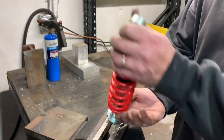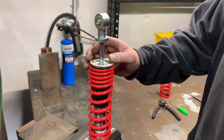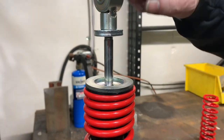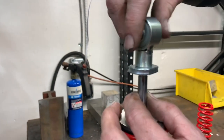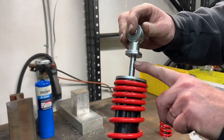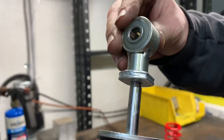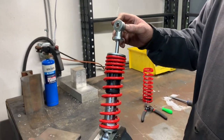Just flip the shock upside down and then everything's basically loose. There's a nut right here — you can loosen that, hold the bolt, and basically screw the clevis off of that nut. Then the spring will come off. Note how many threads you have showing here — there's a couple — because when you put it back together, if you screw the clevis too far on, your shock will be a little bit shorter than it was.